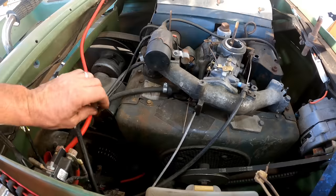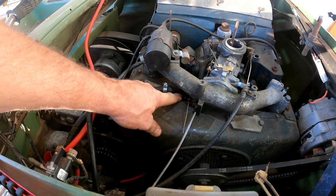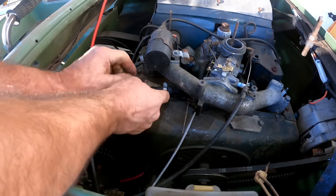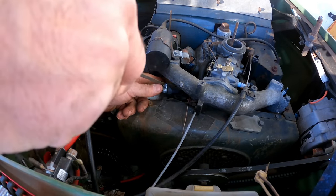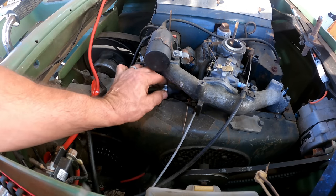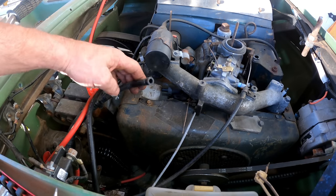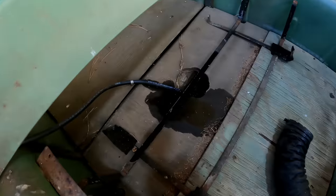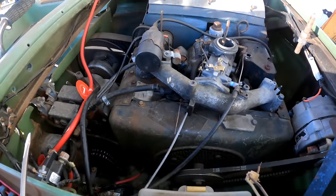That's a cool little device. So here's the other end of that fuel line coming from the tank, and there's a little fuel pump that probably runs off the impulse. So I'm going to undo that line there because it's probably full of that nasty fuel, and there's just no reason to suck that into the carburetor and have to deal with it. It's going to run a lot better if we can get fresh fuel in it. Alright. Yeah, a bunch of that fuel just dumped out into the bottom right there. And I'm going to go ahead and blow it out too.